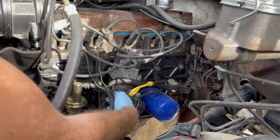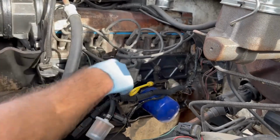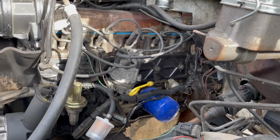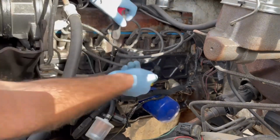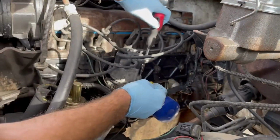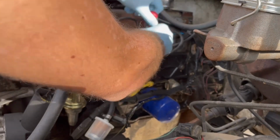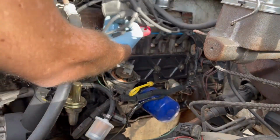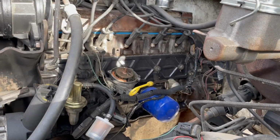But all we're going to do, get the control module unplugged. There's a screw on either side of the cap that we're going to take off. On some distributors, there's 2 clips that come up on the sides and click on. You'll just pop those off. Alright, get this out of the way. I'm just pulling this off for now. Cool.